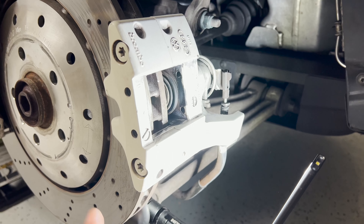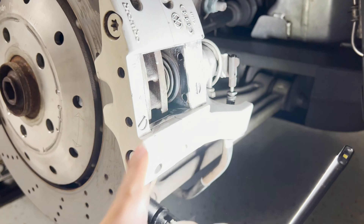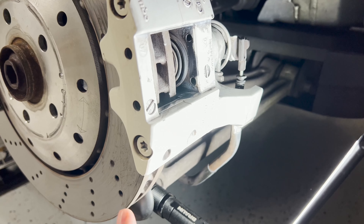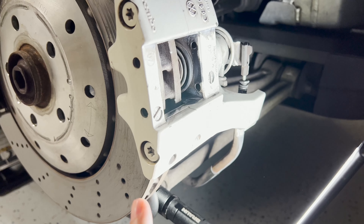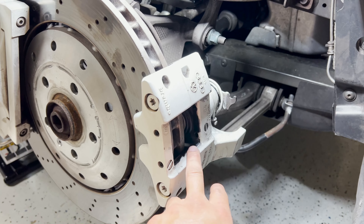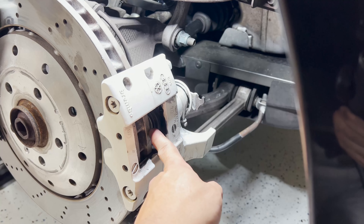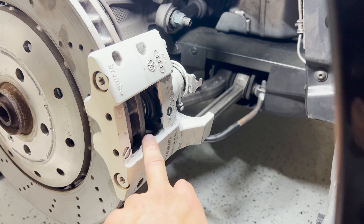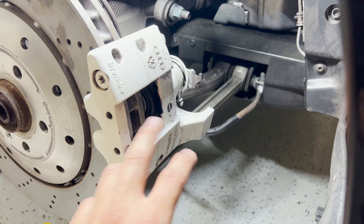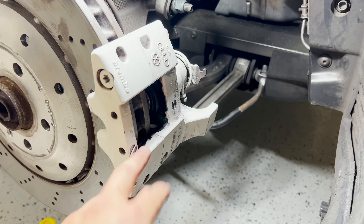After cleaning the entire area with brake cleaner, the service manual says to apply grease on this side, and up top here — it's used to help install the pads and deal with any squeal. Just my luck, the e-brake has been in there so long that the piston has actually gone in really deep and I cannot fit both pads inside. The service manual did warn me about this: if the pads have been broken in quite a bit, you need to remove the caliper.